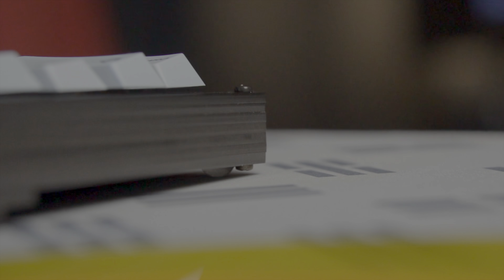Because the Alice layout splits the keyboard down the middle and it splits the spacebar too, you won't find any keys on here larger than 2.75U. So make sure you pick a keycap set that accommodates those sizes and also the right stabs. Because it is a stacked acrylic case, the whole body is just several layers of cutout acrylic. Due to the cutout process and variations, it's going to be very hard to get all the sides and corners to line up smoothly — you'll always be able to tell that it's a bunch of stacked layers. There are just minor variations; some are a little closer to the edge than others. It doesn't line up a hundred percent, but it's not terrible in my opinion. I think it's totally doable and it doesn't bother me in the least.